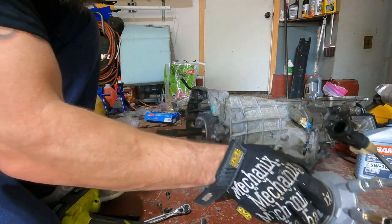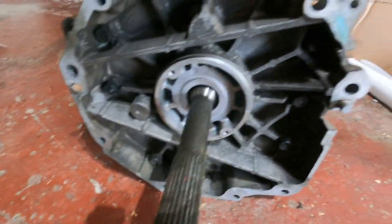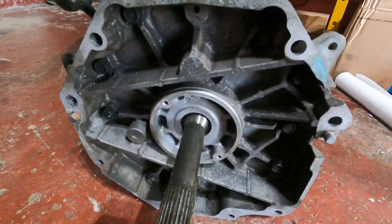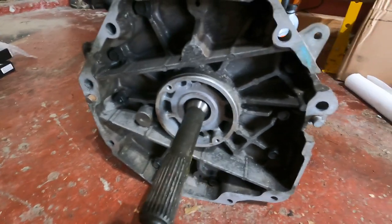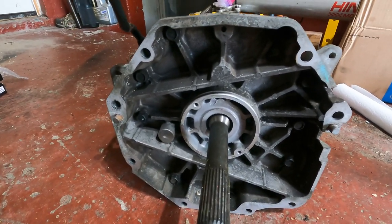Our slave cylinder is liberated. I would throw it, but I'm going to reuse parts so I'm going to gently put it down. And that is what the inside looks like. Now it would be a good idea to spray with brake clean, just clean all the crap out of there because you don't want your brand new clutch getting dirty. So I'm going to spray this with brake clean real quick, clean it up, and go on to the next part.